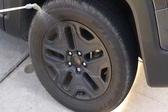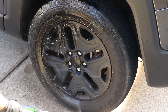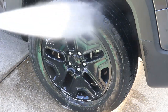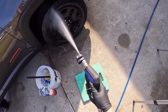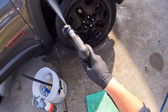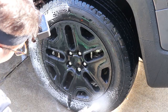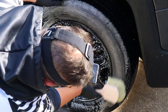Working on the other wheels and tires, you can definitely notice one thing I am a fan of: cleaners with high foaming capabilities. For dedicated wheel cleaners, all-in-ones like wheel and tire cleaners, and APCs or degreasers, I prefer high foaming solutions because they help prevent the product from running off a surface, lubricate it for the contact cleaning, and keep the surface cool with a blanket of bubbles when working outdoors like I am right here.